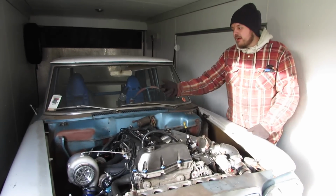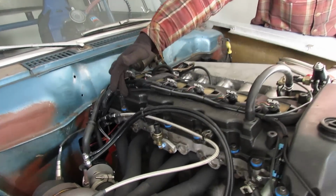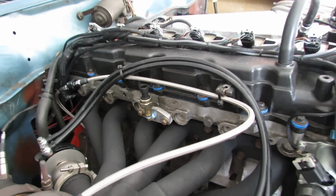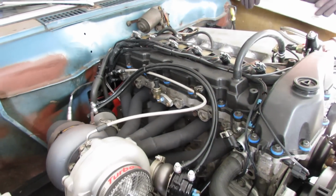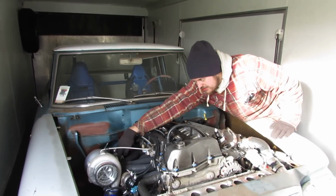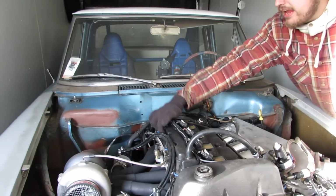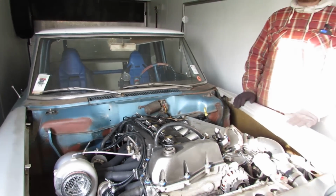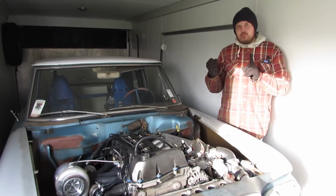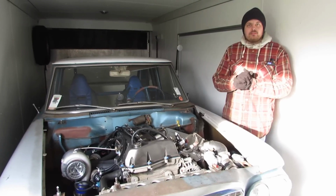In our case, we are actually reading that pressure inside of the exhaust ports. This port here goes down into every single exhaust port. So that is very important to know because it's also reading the back pressure of the cylinder head. So that will tell you if your cylinder head is out of flow. Ideally, what we'd like to see is a pressure reading here just before the exhaust gases go into the turbine and the exhaust pressure in the exhaust port. Because then we could compare the two pressure readings and see how much pressure is being built by the exhaust ports. We didn't have that capability today, but perhaps in the future we could do that.